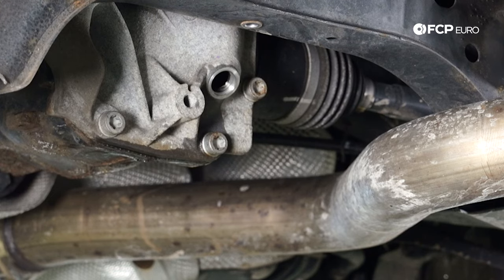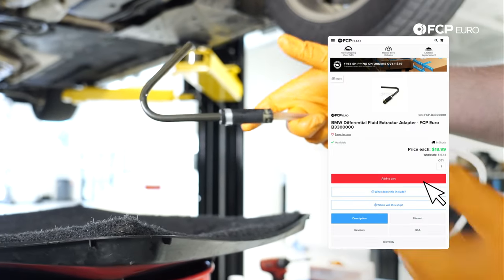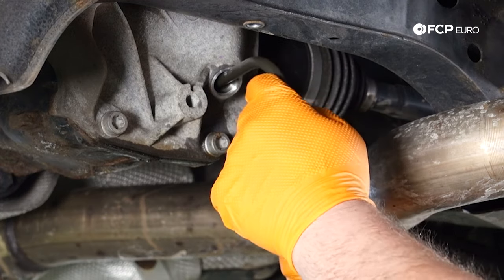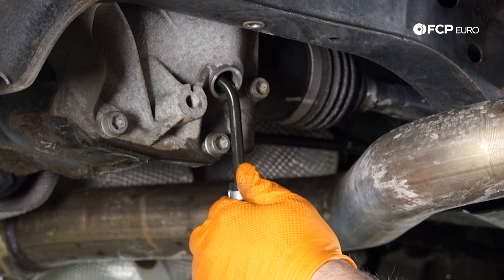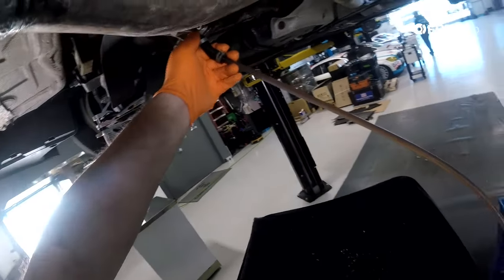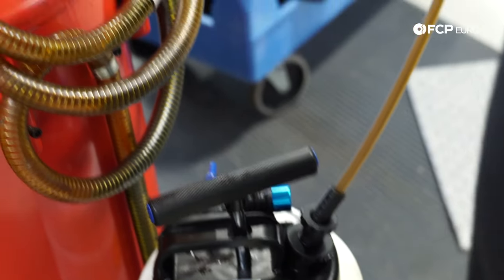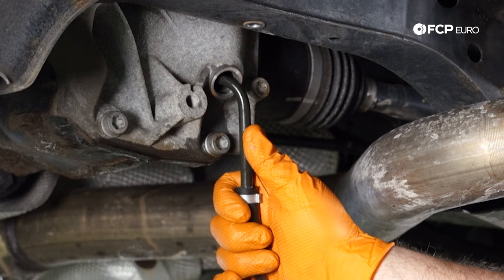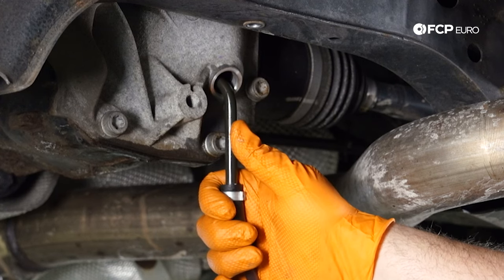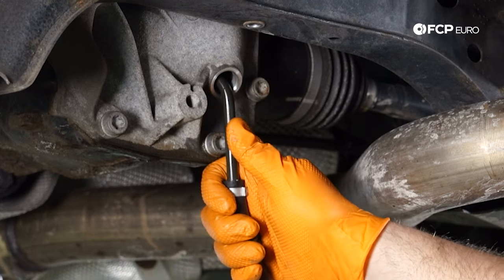This is the part that's a little annoying about some of these newer BMWs — they don't have drain plugs on the diff. We have this special adapter here which you can put onto a hand pump or a fluid extractor. In this case I'm using a vacuum extractor. This will actually go into the diff, hooks in at just the right angle so you can extract as much gear oil as possible. To be honest, you will get a good chunk of the fluid out, similar to if you removed a drain plug. It sort of feels wrong to have to do it this way, but it just is what it is on a lot of these newer cars.